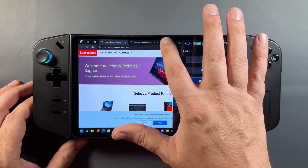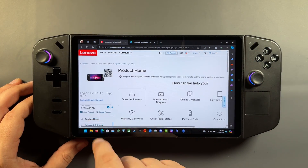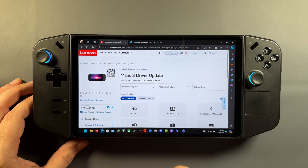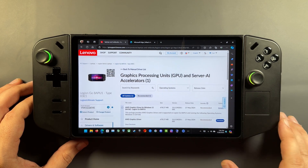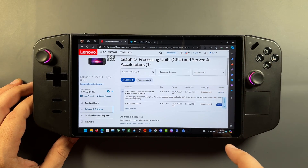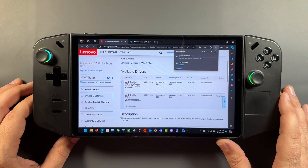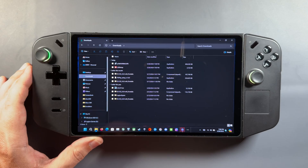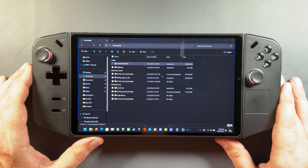The only way I found this was to go into online support — this thing's been out for about three or four days now. Go to drivers, select manual, and you'll be able to download and install the GPU driver. I did it by just downloading and installing over top of everything, and it worked just fine. I also did a clean DDU install after that because I was having some issues, but those issues still persisted anyway, so I didn't get any difference between installing over top or removing and reinstalling.